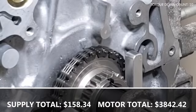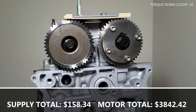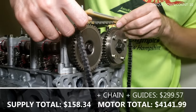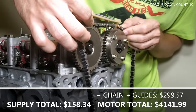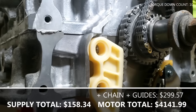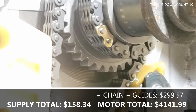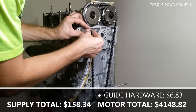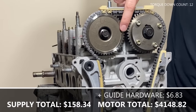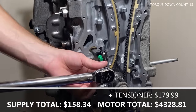Turn the crankshaft until the markings line up. On top, turn the camshafts until the markings and the gears line up as shown. Lock the cams in place on the back side of the motor using the provisions made. Place the timing chain on the cam gears aligning the marked chain links and the marks on the gears. Use the top timing guide to help keep it in place. Make sure the marked link on the timing chain is aligned with the mark on the crank gear. Once everything is aligned, torque down the timing chain guide. Install the main timing chain guides and torque them to the recommended spec. Double check that all the markings are still aligned. Place the chain tensioner, torque it down, and pull the pin to release the tension.